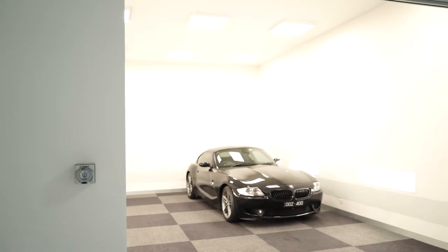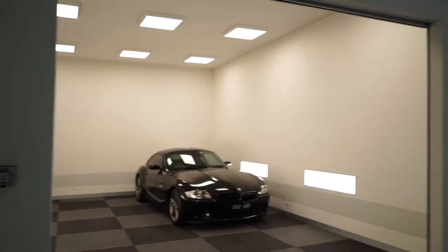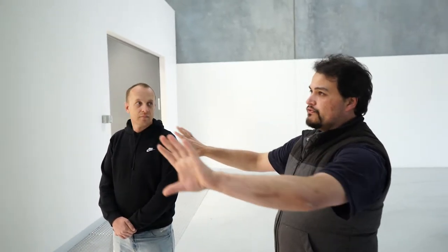And this flat lighting, this is really important for being able to see the coating go on correctly. That's correct. It's all diffused LED lighting. So there's two main types of lighting, and we'll talk about it more in the detail. Two main types of lighting we use are direct lighting and diffused lighting. So the diffuse lighting gives you more of a softer lighting, which is good for general lighting, but it's also much better for seeing coatings flash on the paintwork and being able to make sure that you are correctly buffing off the coating and leveling it out and not leaving high spots and things like that behind. So again, the overall end result is a lot better.